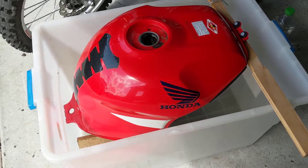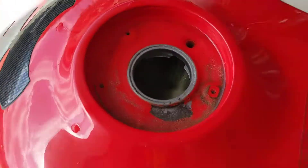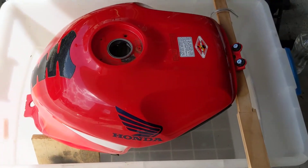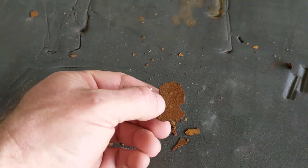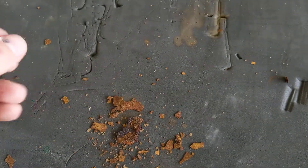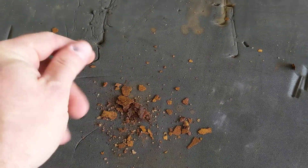It's been about a week since I did the vinegar treatment last weekend. The temperature went really cold on Sunday so I didn't get around to doing it, and a little bit of surface rust did form over the last week after doing the vinegar. But it was dry, and when I upended it, this is what the inside of the fuel tank was coated with — four years of sitting without fuel stabilizer, without running fresh fuel through. The inside of the tank is coated with that stuff, and it stinks something shocking.